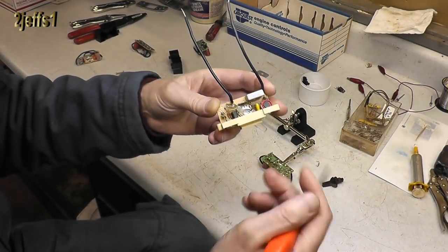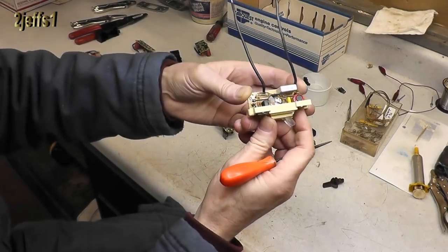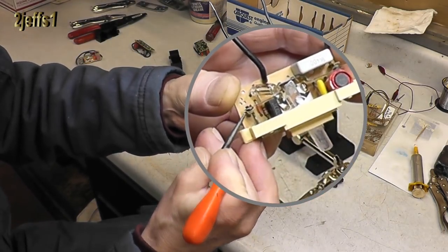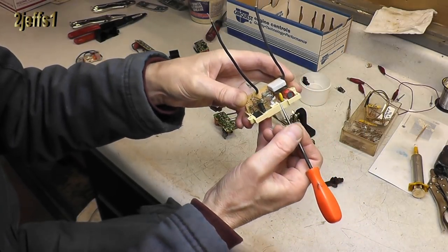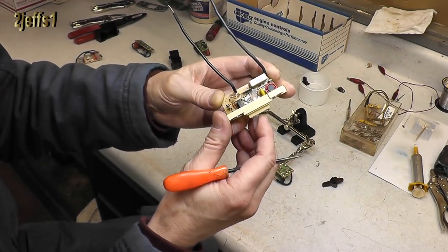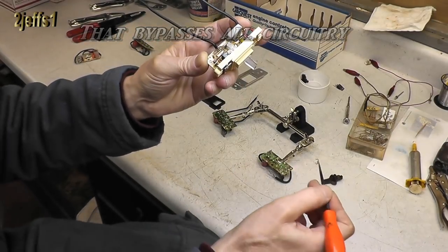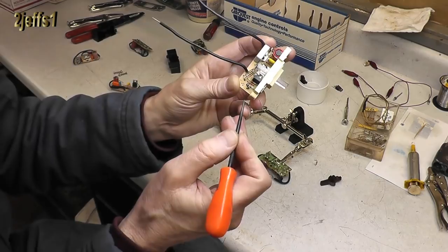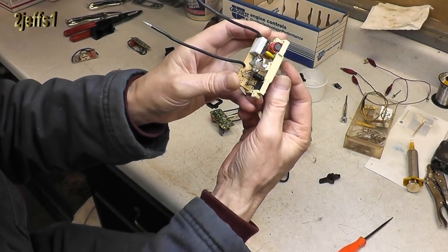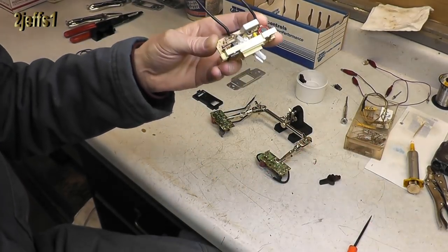Let me show you first what's going on here. On your dimmer switches, you've got the ones with the knob you push in — well, that turns on your circuitry for the dim mode. What they have on these is a set of contacts right here. All the circuitry is off right now until you take it off that. These contacts close, and now the circuitry for the dim part is energized. What's neat about these switches is they have a feature none of the other ones do — when you go full wide open, them contacts right there close, and then you're going to go full intensity on your light. The black handle ones had all the holes in the circuit board, so I could just put a new neon tube in, grab the resistor, and I put white grease on everything to lube it up so it works way nicer. I cleaned the points where there was a little bit of skunk on these where they were sitting for quite some time, just to make sure when you're all done they do work.